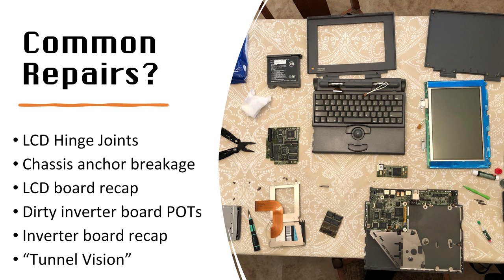It's amazing what a 3D-printed part and some glue and a replacement screw post will do — you could open the hinge 100 times and it won't be sad. More than anything, it can address some of Apple's original design flaws with the LCD hinge. You also have to be careful because 99% of the time with PowerBook models, the ribbon cable either wraps around the hinge or is adjacent to it. So if the plastic breaks and the LCD is no longer really supported, you might rip the little ribbon cable, which is very, very fragile and delicate. Those are very difficult to repair — sometimes impossible. You might be able to find a replacement screen, and if it's a cracked screen but the ribbon cable is okay, you're in luck. So look at very detailed teardown videos of the specific model you're attempting to repair before you go and open it.